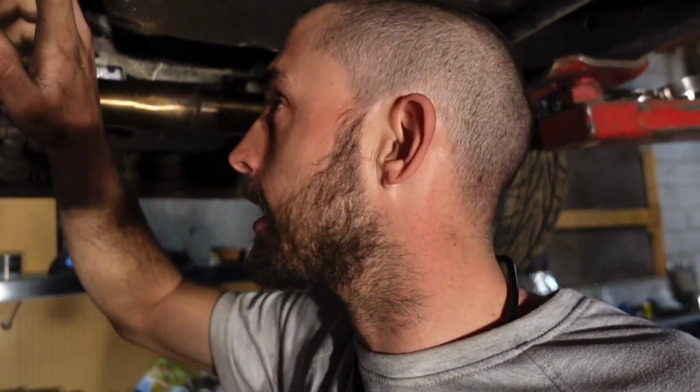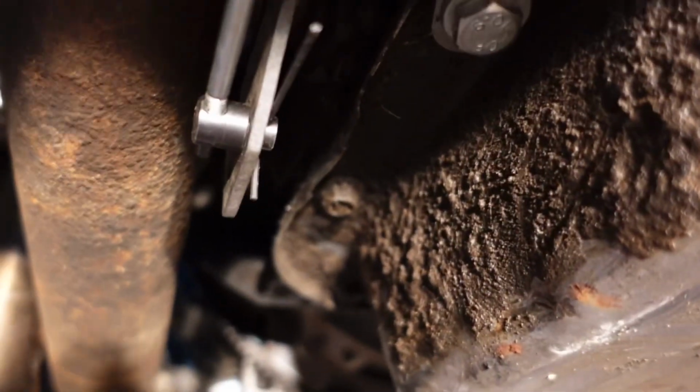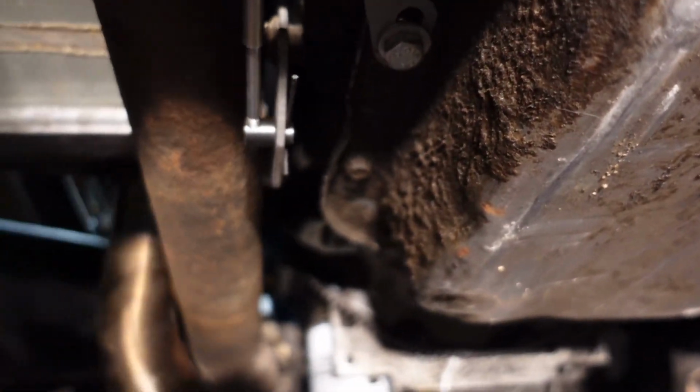And all we needed was a stock U-joint for a 2500 front drive shaft. They're both 1310s, and it bolted right up. So super exciting. I couldn't find anything online, so I hope this helps somebody, because it took me all day, but I finally got it figured out. So we got our shifter installed, like I said, and the shifter works. I can't even show you on camera how close it is to the drive shaft, but it clears all the way from park back to first.